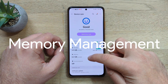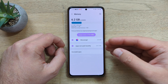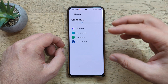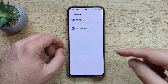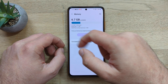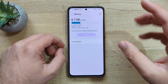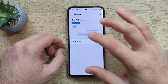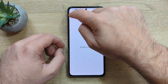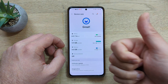My next tip is gonna be memory management. Click inside Memory — you can see a Clean Now option. I can already gain 800 megabytes of free memory, so I'll press the button and you can see the phone cleaning the RAM — the random access memory. Right now I have 3.6 gigabytes used out of 12, so I have almost 7 gigabytes of free available memory. If you don't want the phone to kill one of your favorite apps, go into Excluded Apps and add them to the list — every time you perform a cleanup, those applications will be excluded.